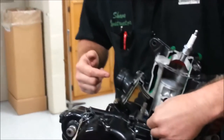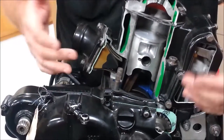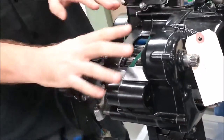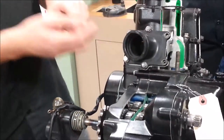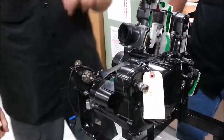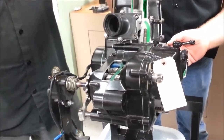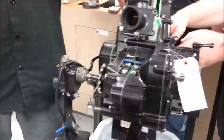The base gasket — is that a place where air could get into the engine? Yes. On this Suzuki, do you see how it uses a gasket? This is part of the transmission, but there's a sealing ring around just the engine case right here. This could be sealant. Out of our list, we were down to one more thing: the left crank seal. That's 99.9% of the time.